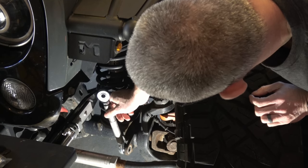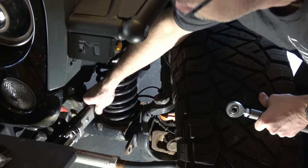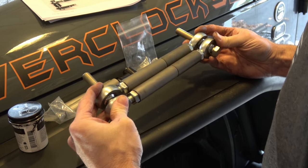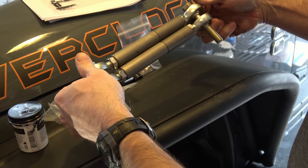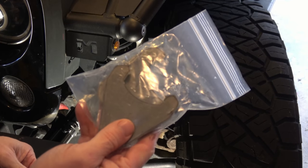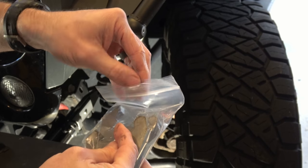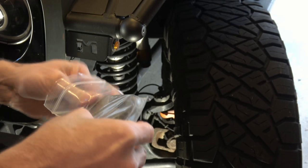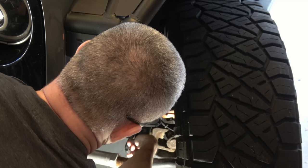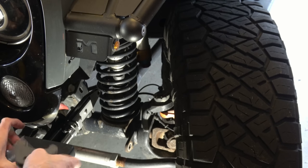Go ahead and do my test fit, and then I work on aligning those joints so that they line up properly. One thing that's important to note is that while it's okay to start out with having the links on each side be the same length, in the end that matters less than getting them fit perfectly to your Jeep. Also in your kit comes these little tabs to reinforce the mounting location for the links where they mount to the axle. I don't need this because I have an aftermarket axle that already has beefed-up mounting points, but if you're running a factory axle, they recommend using these and at least bolting them in first and then welding them later.